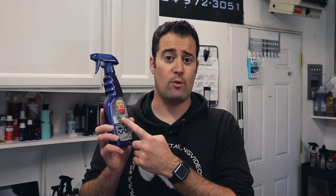Nothing extensive, no paint enhancement polish, just a quick once over with a simple polish that is very easy to work with, say something like Meguiar's 210, which is just a fine polish that will get rid of any marring, clean the surface, gloss it up, and then you can spray the vehicle down with water and use this. I know it's kind of an extra step. However, you will love the results of this stuff. Then all you need to do after is blow the vehicle dry and just use one microfiber to sop up any of the little drips that you might have, because this stuff produces some awesome beading action.